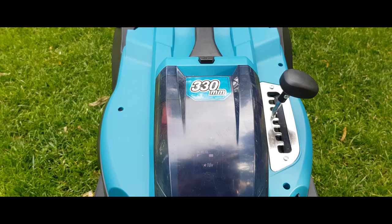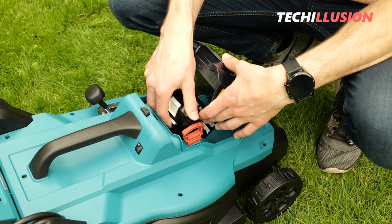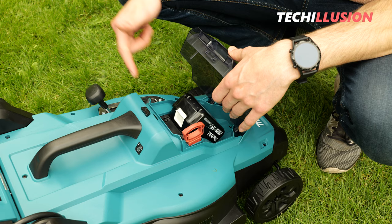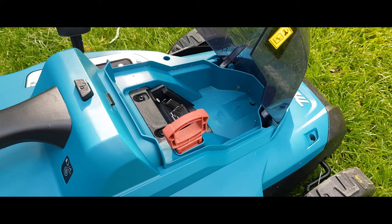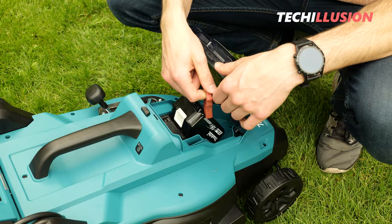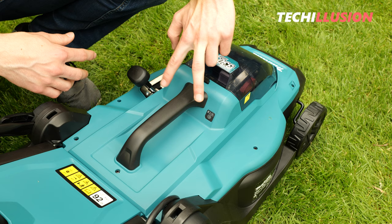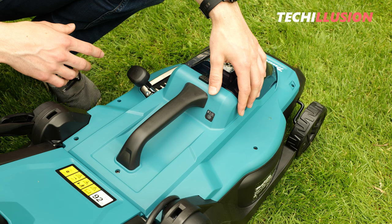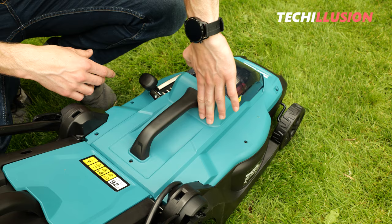The cover is oriented so that it closes on its own naturally, preventing grass from entering the battery compartment when you're not around. The 18 volt battery is inserted from the top into the compartment, and next to it in red is the crucial safety key — essentially a bridge for the two contacts. Without the key inserted, the lawnmower cannot be activated. The DLM 330 also has a battery status indicator with two LEDs; the right LED signals when the battery is running low, positioned directly in the user's line of sight while pushing.